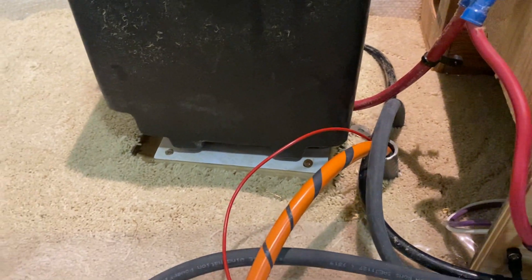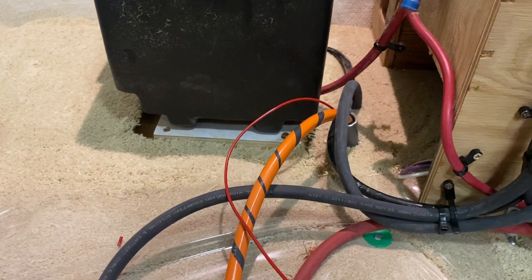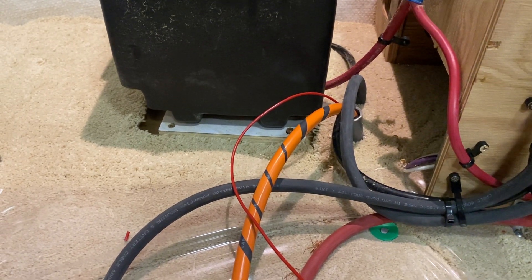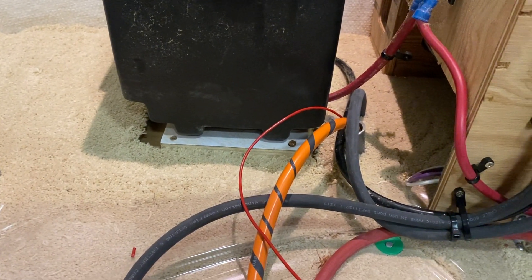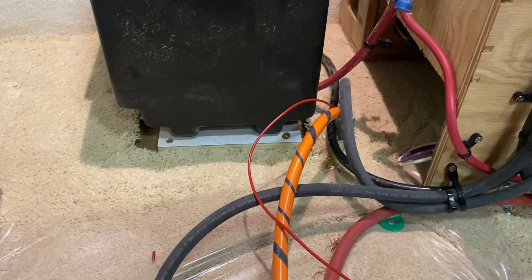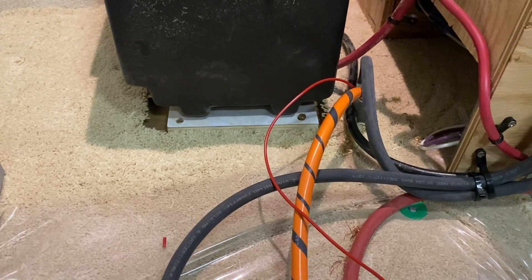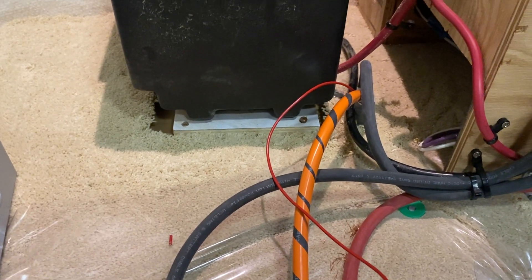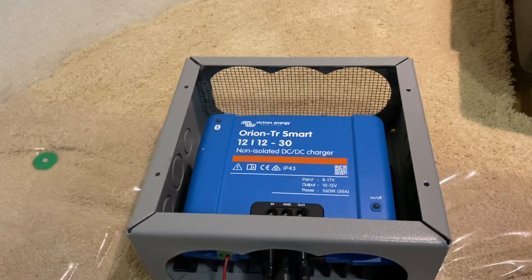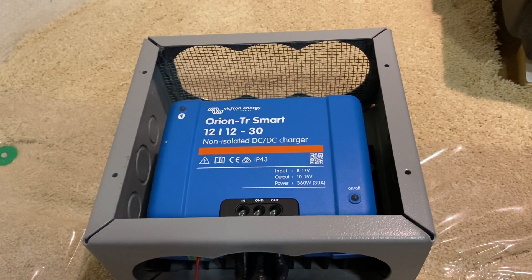The little red wire is an optional manual disconnect for the Victron. My Ford truck comes pre-wired with upfitter switches, so it was pretty easy to hook up in the truck since it already had allowances for accessories like this. When the switch is turned on, this wire just carries a plain 12-volt signal — it doesn't carry any significant current, it's just a signal that tells the charger it's okay to come on.